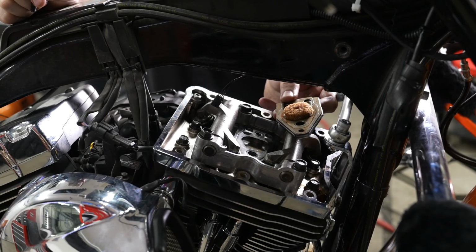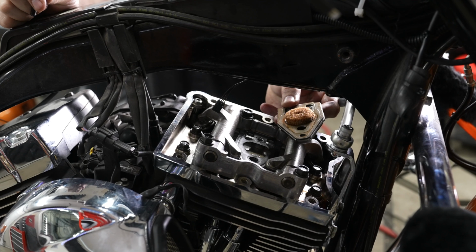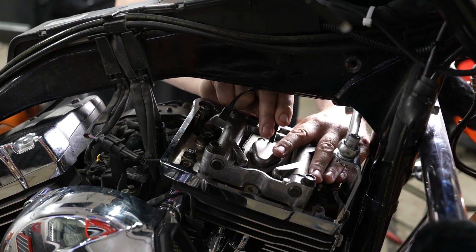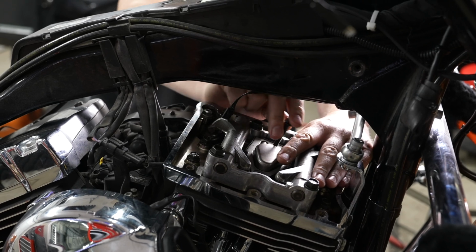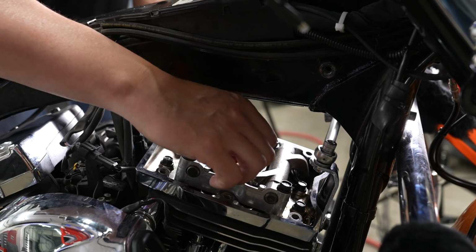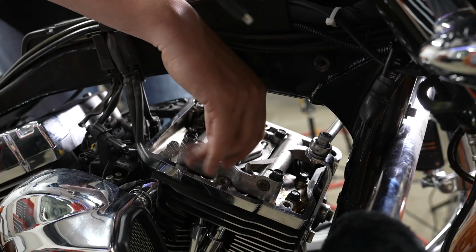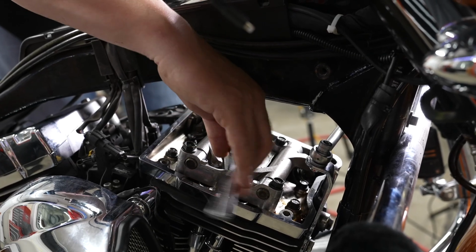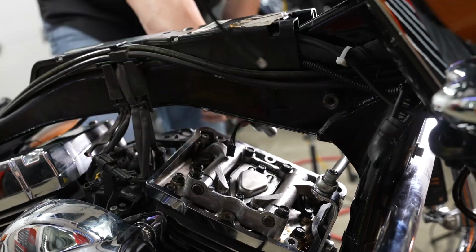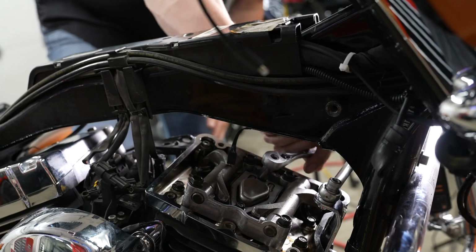All right, now we're going to put our breather assembly back in place. Just make sure the filter is secured there. And he'll position that back there. And he'll get his 2 bolts, at least finger started, get everything lined up here. And just the 1 bolt on each side. And he's going to go in with his 7/16 inch socket. And again, just seat these just till they start to make contact. Move over and do the same to the other, and then we'll torque these down.